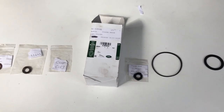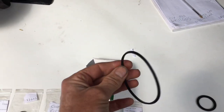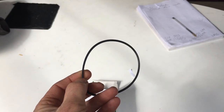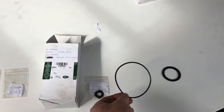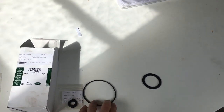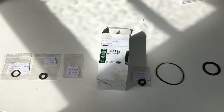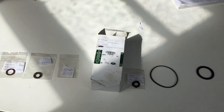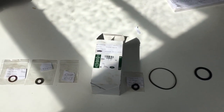In addition to all of those parts, just make sure you don't make the same mistakes that I made. When you're putting that washer on the car, make sure it is seated properly. Go around with a little screwdriver and really make sure it's flat. You can save yourself a whole heap of work making sure that that is in the groove properly. Make sure you've also got a bit of good quality kitchen roll to catch any oil, and that you obviously have something underneath the car to catch the oil, not just from the sump plug, but also when you take the filter off.